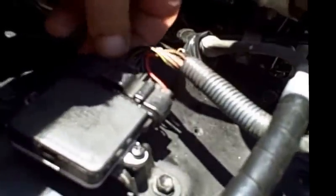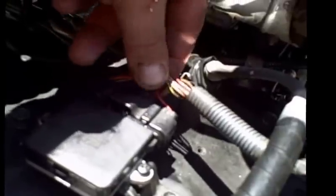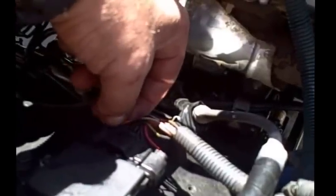In the case of doing troubleshooting like I did, I probed a lot of the wires, so I need to go through and find those little holes. I know I shouldn't have probed it, but I did, only because I'm going to use some liquid tape and just fill up those little holes. It's important you don't want to get any corrosion in there. So anytime you probe anything inside the engine, just go ahead and put a little dab of that liquid tape on it, and that should be good to go.